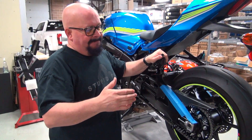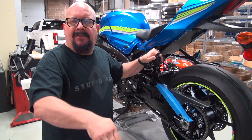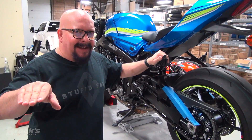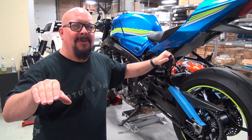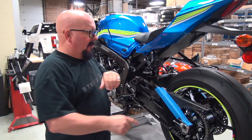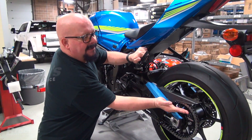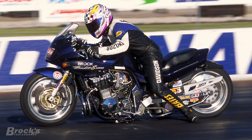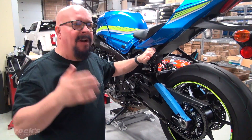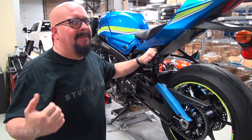On a bike like this, we really don't have to worry about upsetting the attack angle so much because even when we upset it, the bike's still going to work great. On my Bandit - which is a 1997, over 20 years old - my swing arm was almost parallel to begin with. So as I apply power, launch, transfer weight, all the torque of the engine is yanking on the top rung of the chain. If this is level, all of a sudden we're pulling it away from the track. I used to go across the finish line with white smoke flying off of my tire like an old dragster because that bike just wasn't set up as nicely as bikes like this today.